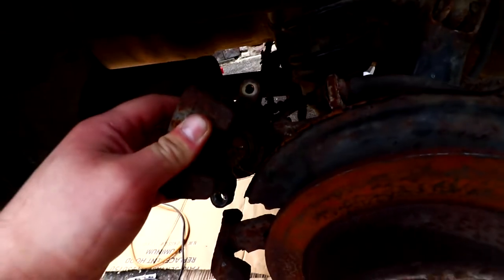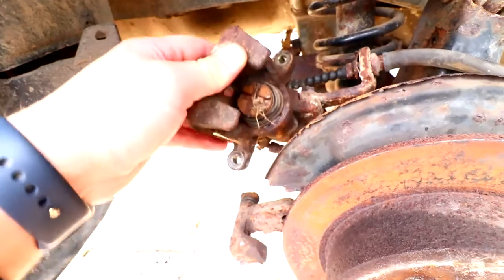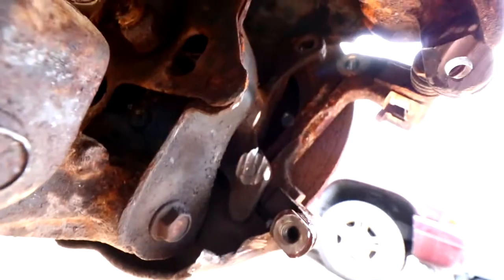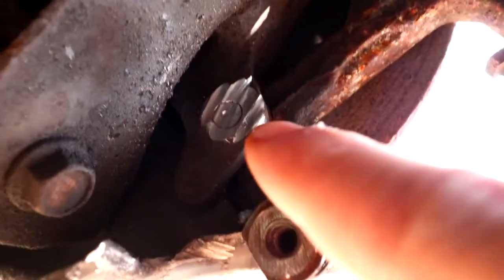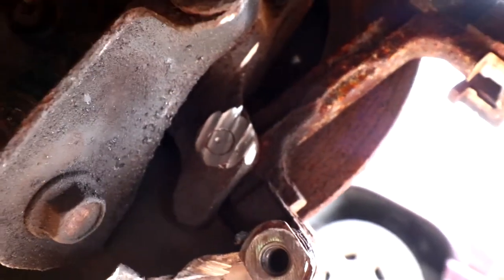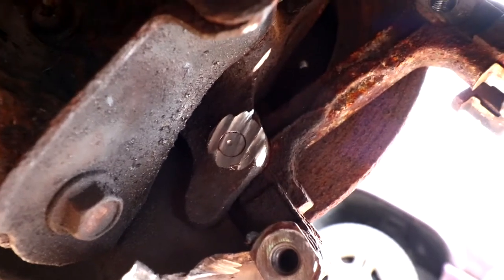Little update: I got half the caliper off. I managed to grind the bolt off and then drill through the bolt, so this is how it looks like. Caliper is off, pads are off. Let's look underneath. The bolt that I've been working on for days now — I grinded it as much as I could, and where the circle is, that's the rest of the bolt. I'm gonna drill right through it and hammer it out. Almost there.